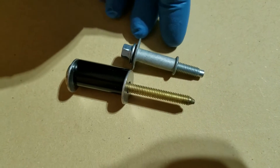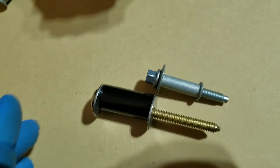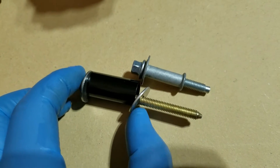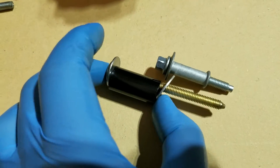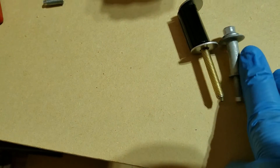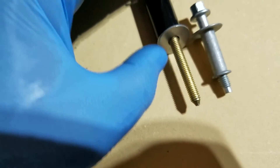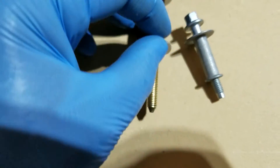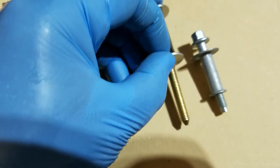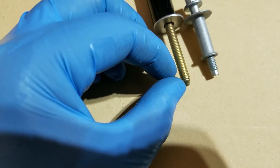Normally this piece would sit inside the manifold and you'd only see the head of the bolt. My bolt was much longer, so I put together a contraption: a big washer, then a metal tube, then another washer. The length of the portion going inside was actually very similar — only slightly shorter, by maybe the thickness of that washer. I knew only that much thread was going inside, so I wasn't causing any issues.